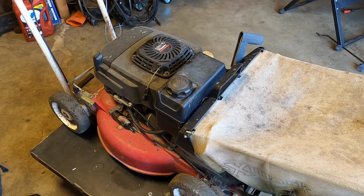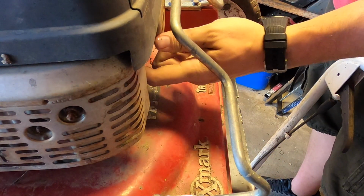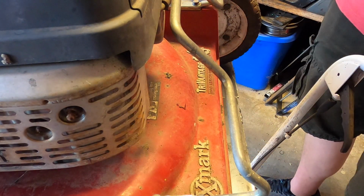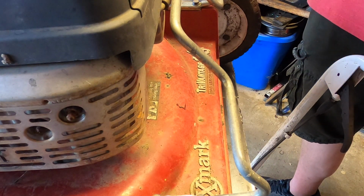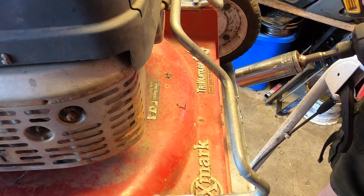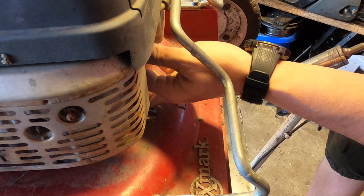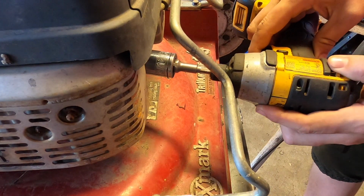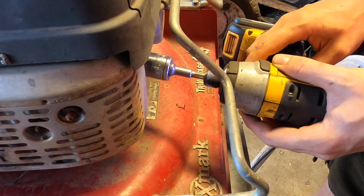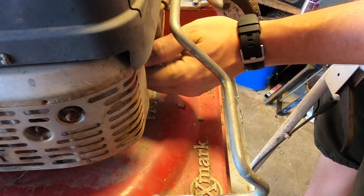We might have a hydro lock or maybe just a stuck piston. Liquid cannot compress, at least not any liquid I know of, and fuel is a liquid. Now, does your engine compress air and fuel together to create the necessary power? Yes, it does. But there's too much liquid. Your piston just hits it and rams itself in there. It won't move any further. When that happens, you have something called a hydro lock. Your piston will just sit there.